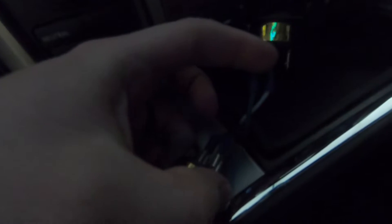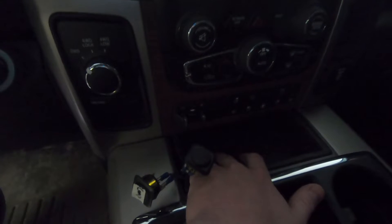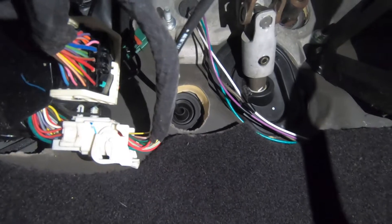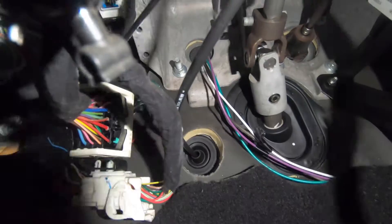We have two switches — one for the compressor, one for the horn. Each switch has two wires: one is power going to the battery, and the other is load — one going to the compressor side, the other to the horn side. They're essentially just trigger mechanisms. The pods will have six switches total, wired cleanly, running down and under the pedals.